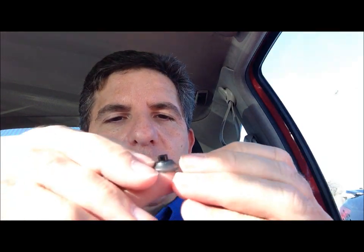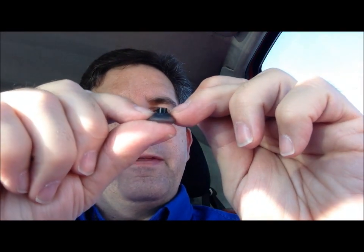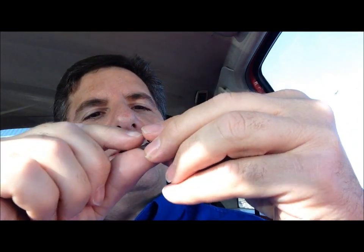The one I found that fits on there pretty good is size 15/16 by 13/16 by 1/16. If you go to the local hardware store, they should have O-rings — I found mine in the faucet repair department. The little O-ring fits right around the shaft area here, so I'm going to put it on like so.